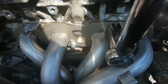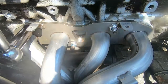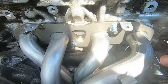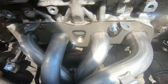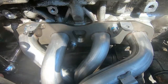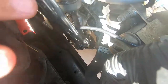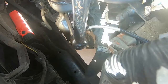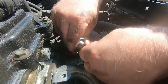44 foot-pounds — not crazy tight but good and snug. I started with the second one to the right, then once that snapped in I went to the left side. That's all there is to it; once this is done we move on down to the rest of the exhaust. It's important to tighten these down to the right spec — over-tighten and you risk an exhaust leak or warping. Here I'm tightening down the O2 sensor to spec: 38 foot-pounds. Once it's snugged in, plug in your O2 sensor — it should just click right in.